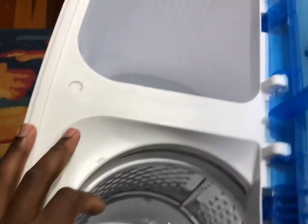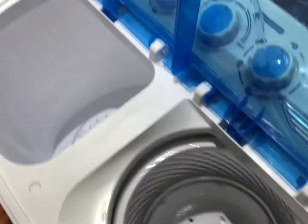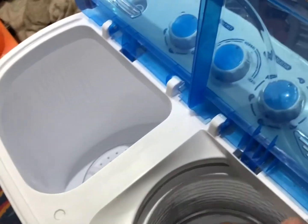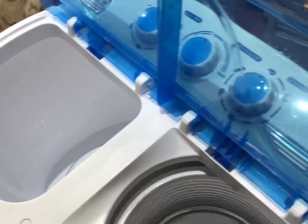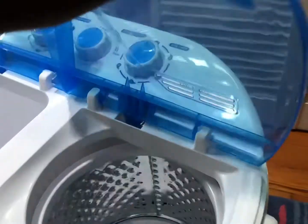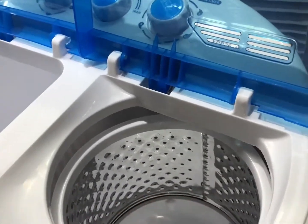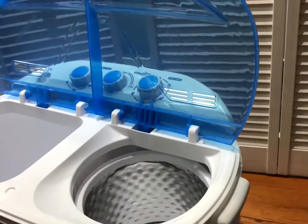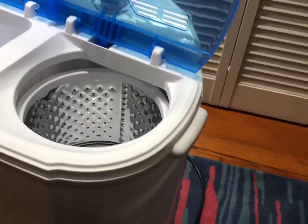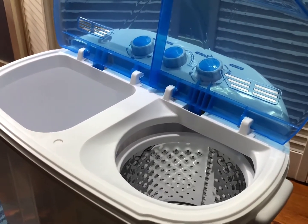Another thing with this washing machine is that the brakes on the dryer — I think the cable that connected them snapped. Now the dryer kind of spins freely. What used to happen was that when you open the top, the spin dryer would shut off and the brakes would get it to stop. Instead, the spin dryer just keeps on turning and doesn't stop, which could be kind of dangerous.